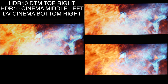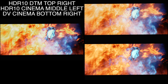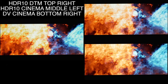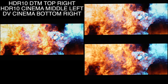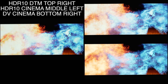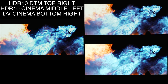So it's kind of in between the two, but at least with Dolby Vision you know what you're seeing is the amount of detail you're supposed to see. With HDR10 you don't know if it's clipping something that is supposed to be clipped or not. And when it comes to details like this, if you just have your one display without a side-by-side comparison, detail that's not there — you don't know what's not there because you don't see it. With Dolby Vision it alleviates that, knowing that the detail you're seeing is the detail that was meant to be there.